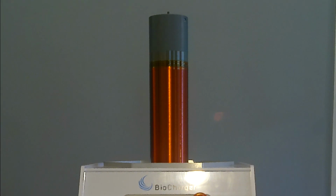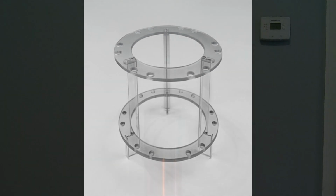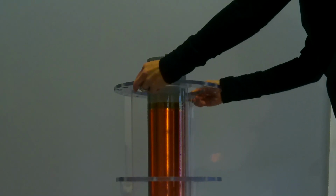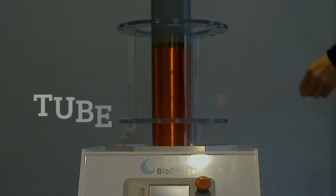Slide the tube carousel over the secondary coil. Make sure not to scrape or rub the red protective coating on the secondary coil. There are three divots on the base of the biocharger NG. The legs of the tube carousel have notches that will rest inside of these divots.